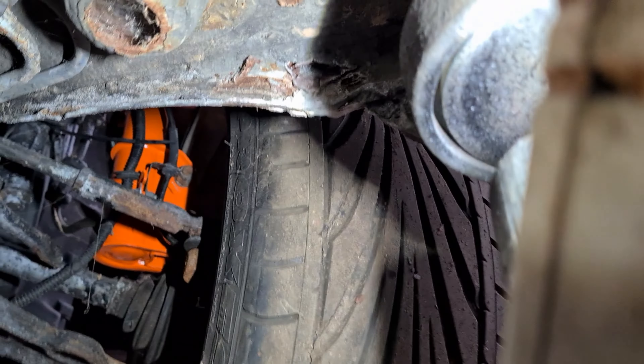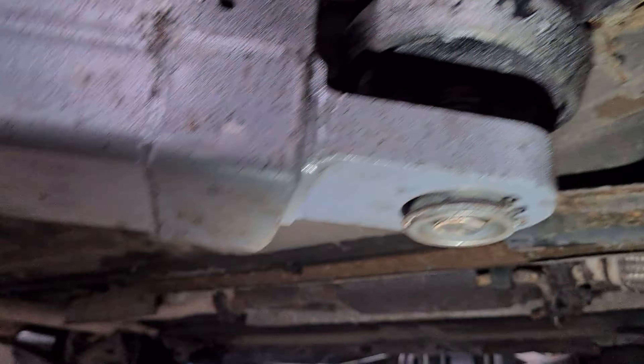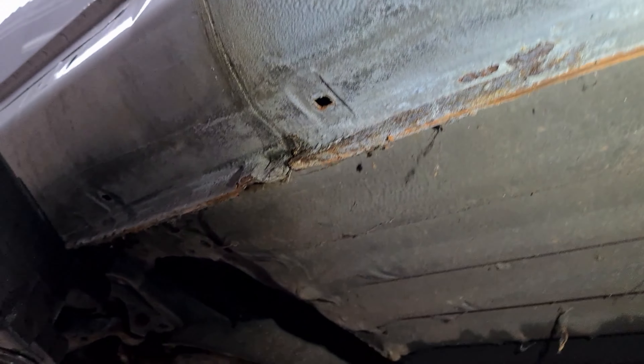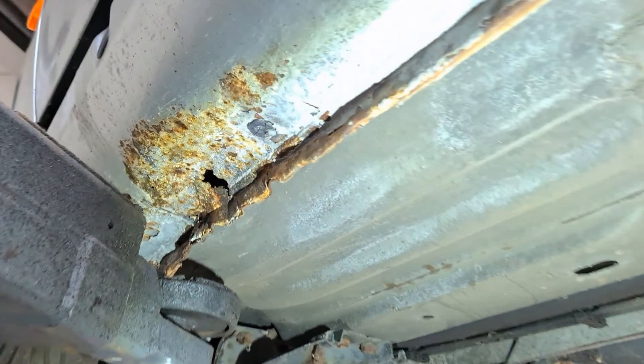To the front again - that's okay. Looking at the outer sill from underneath, rust is coming through there - a big hole. It's going to want welding all the way along there, treating and then sealing on the inside. The other side needs more welding along here as well and plenty of rust treatment. Not going to bother going over the bodywork or the interior because it's been sitting for ages so it is all dirty and manky. I have had the go ahead to get the cam belt done, the brakes, suspension bushes and the welding - so I've got plenty of work to be cracking on with. At the minute I've got nothing but Alfa cam belt changes to do - I've got about five booked in over the next week and a half.